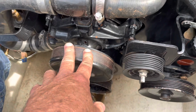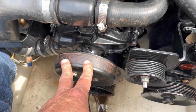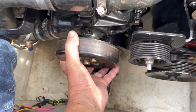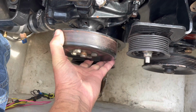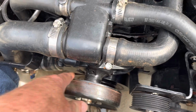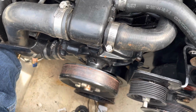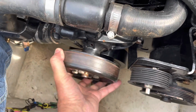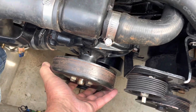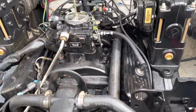That's complication number 4. It's kind of my stupidity. I should never have put it on. I thought maybe if I put it on and got water running through it, the bearings would clear up. I put some WD-40 down in this hole, and it helped a little bit, but it's not going to make it any better. So this water pump's got to go. I've already got one to replace it with, so I'm going to go ahead and remove the water pump now.